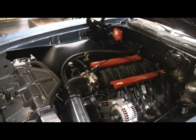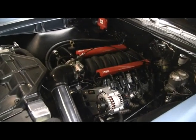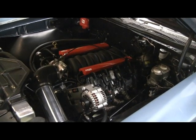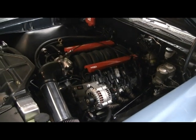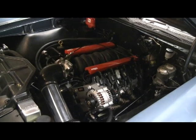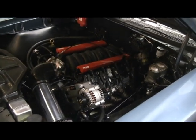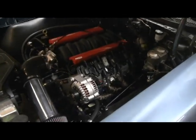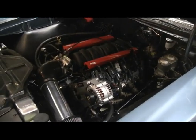After the car show I put about 300 more miles on the car and still had a slight oil leak. I also didn't like the way it shifted — it shifted a little hard into gears, and I could not get it to stop clacking when shifting into reverse, which isn't synchronized. So confession: I yanked the motor and trans out because something wasn't right and it needed to be right.